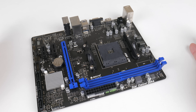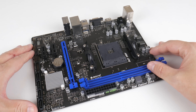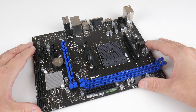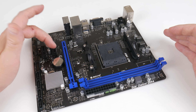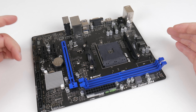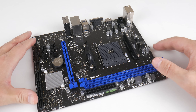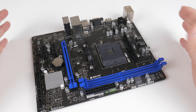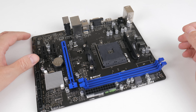Let's have a closer look at this mainboard — it's tiny. It's even a little bit smaller than micro ATX, and it will look fairly bare bone in your case. We do get a PCIe x16 and two x1 slots, a USB front header, USB 2 front header, four SATA 3 ports, and two RAM slots. So all the usual stuff is there, but what is missing is an M.2 slot — on this one you can only use SATA drives, no M.2.